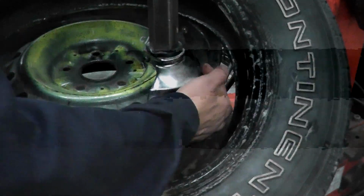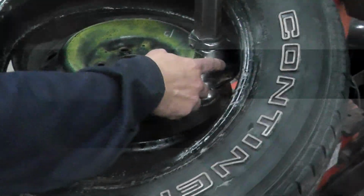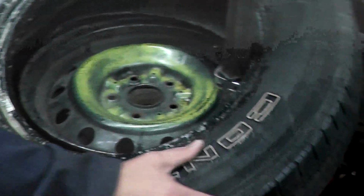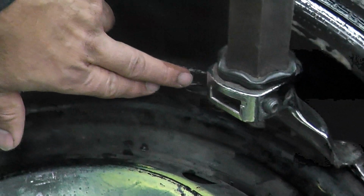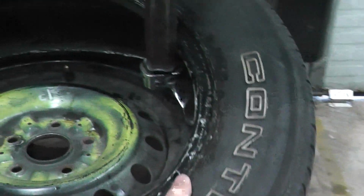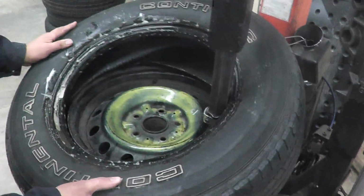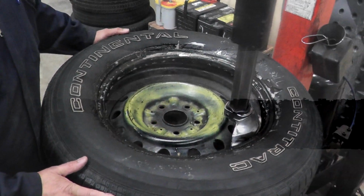So our tire has to be right in here. So make sure your tire is sitting like that. Okay, can you get that? Okay, and you turn it clockwise as much as you can. So have a look how it's sitting. That's how it should be sitting, right there on the tail side. Once you have it there, we have turned it clockwise as much as we can. You don't need to really force it. Hold it down, spin the table, and our bottom bead is on.